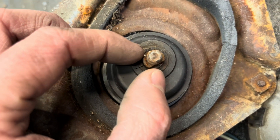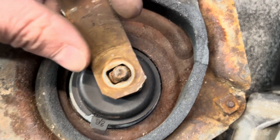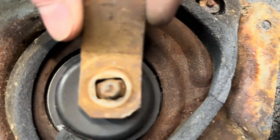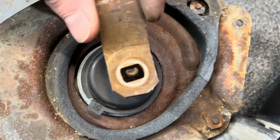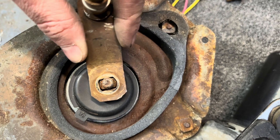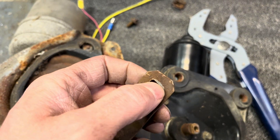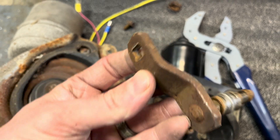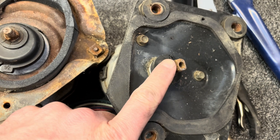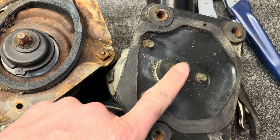This is a little bit more narrow. So looking at it this way — this is off of the Ford, sitting on the GM bracket — it fits perfectly up and down but you have a little play. So all I'll have to do is just run a little file on the inside of the GM bracket and it'll slide right down on top of the Ford, put my bolt on there, and that'll be perfect. No issues there.